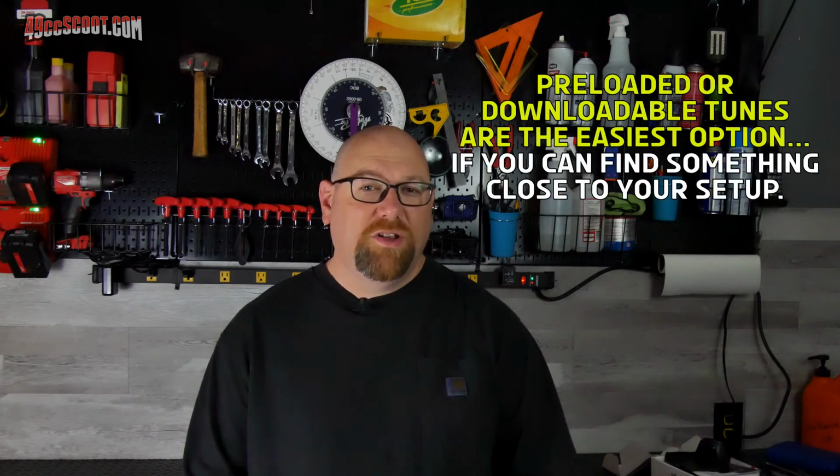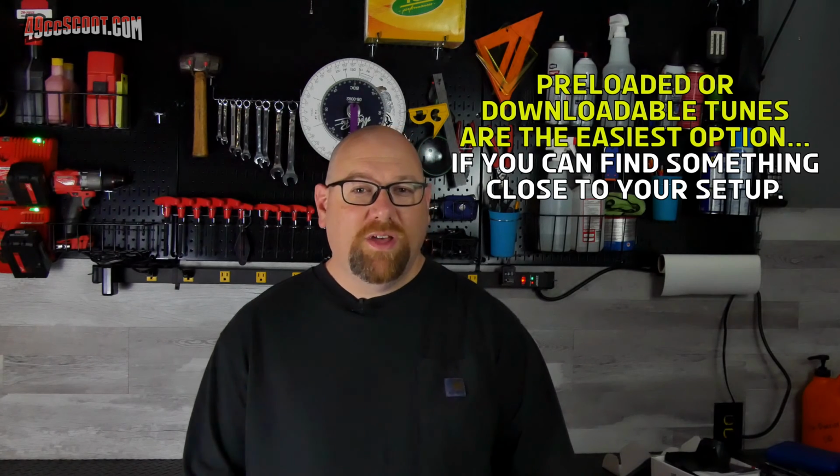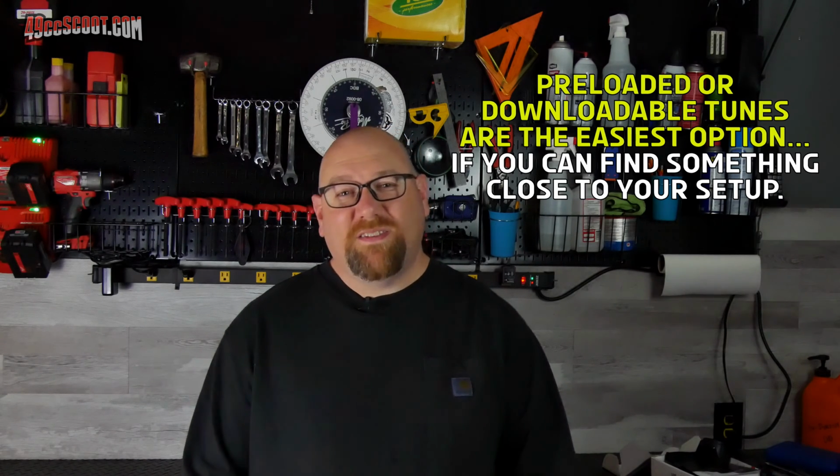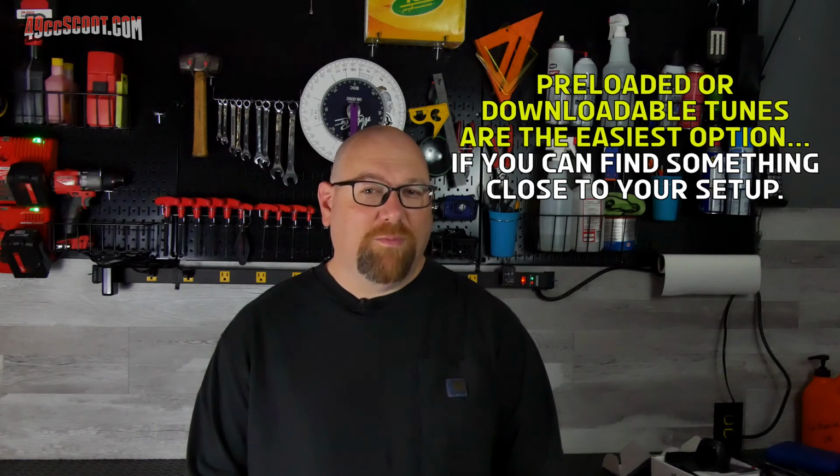If possible, find a fuel controller that has tunes included or available to match your setup. In my case, the Malossi unit has a tune for Malossi's exhaust and an air filter. I'm using a Yoshimura exhaust and a Malossi air filter, but this is as close as I saw for a preset tune that matches my setup in anything available for my bike.